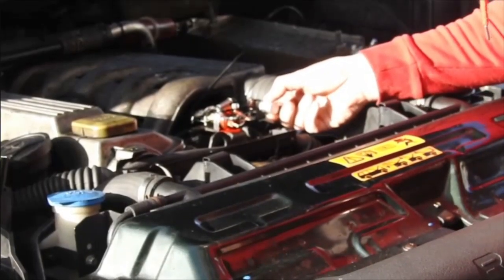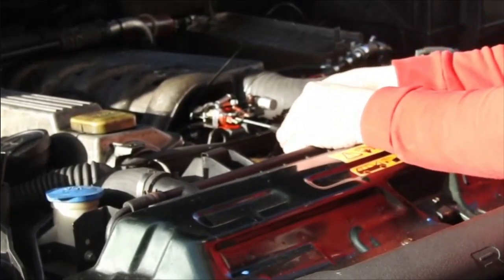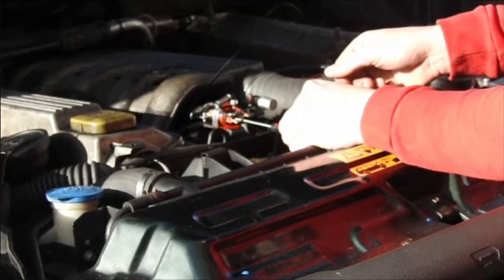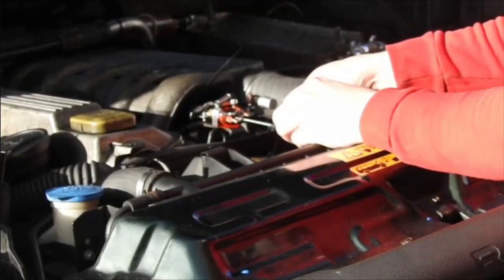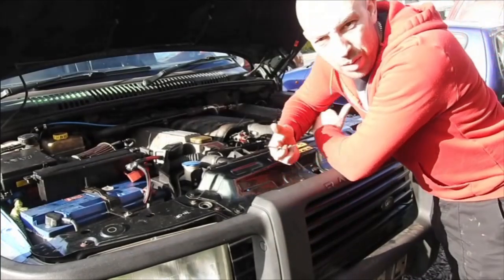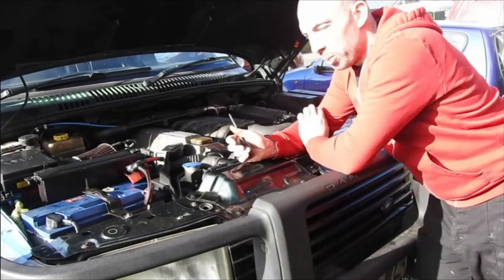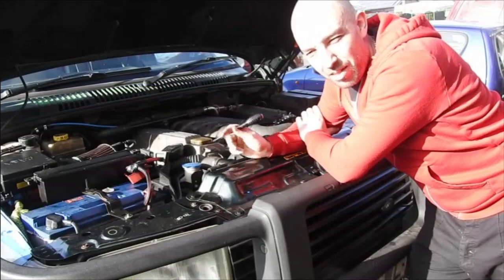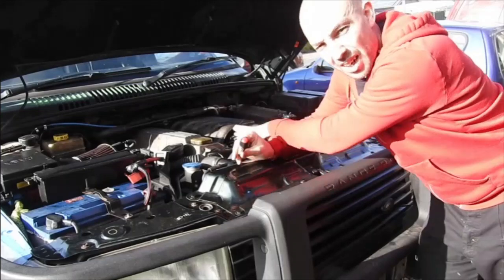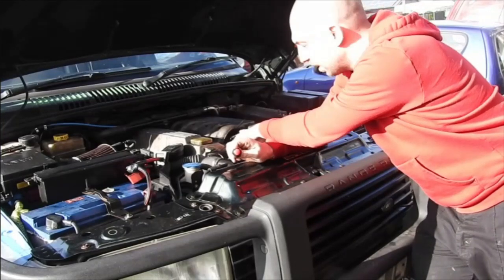This here is the adjustment knob for the potentiometer. If the screw is turned out on the switch, it comes on with the boost provided by the turbo. Setting it back maybe a third to a quarter works better — it performs a lot better, it's got a lot more grunt. When this boost switch turns on, which I reckon is around about 3 psi, it switches the resistors on and you can really tell that it's got a lot more grunt. This has been quite successful in terms of getting it to idle properly.